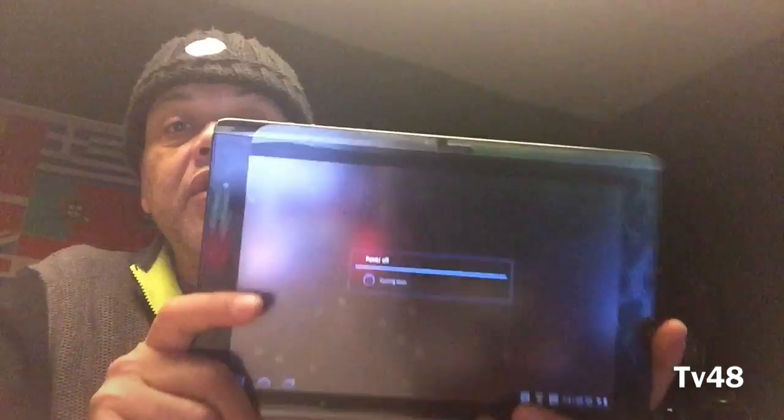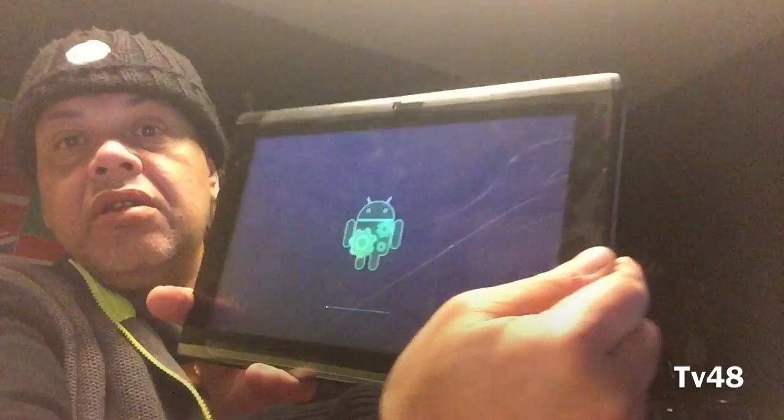I'm just going to turn off the tablet and say we want to turn off. Now we're going to start up — let me see which one is the minus. I think the top one is minus, the volume down. So we press the volume up and then we let go. And then: booting recovery terminal. And there we go baby!